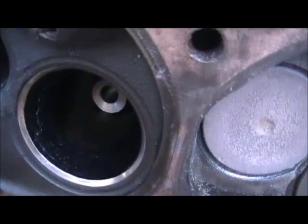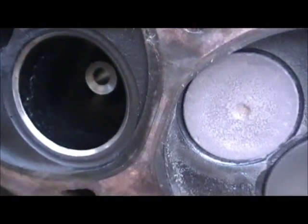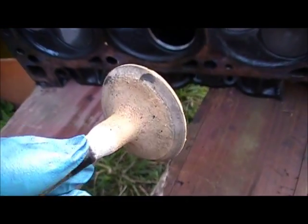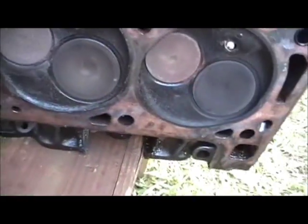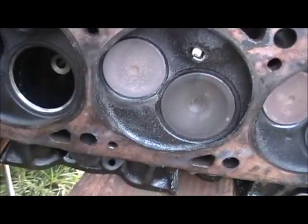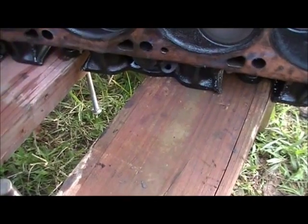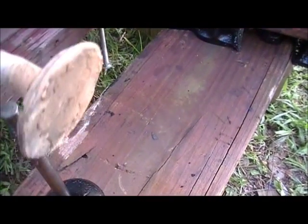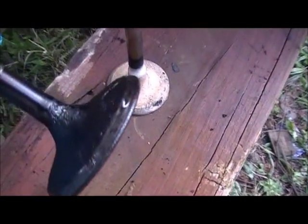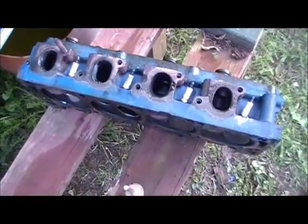You can see the valve seat — it's not bad. It just needs to be lapped. I think a new valve, I can lap it in, and it should seal. It'll run again and be okay. Here's the old valve — it's kind of rough. It couldn't hold compression any longer. When I rebuilt these, I didn't put any guides or anything; I just replaced the seals and lapped the valves. When I worked on this once before, I think that was the one I was questioning about replacing, and I think I ended up keeping it anyway. It's going to have to have a new valve put in it, but I can lap it and it'll be okay. It'll be running again shortly. Thanks for watching.